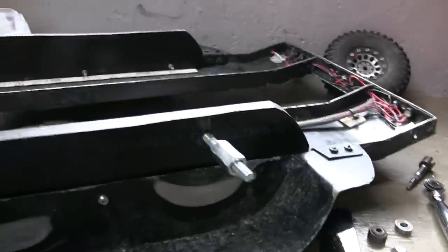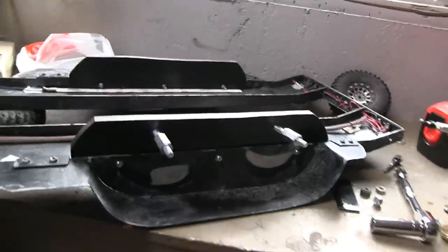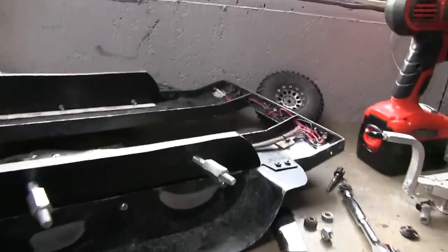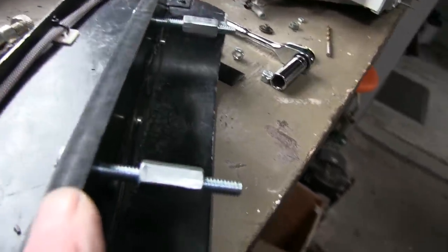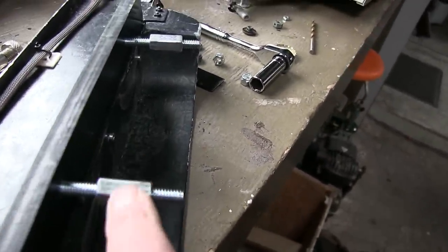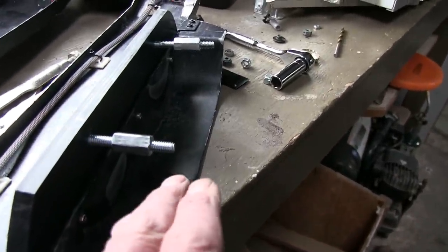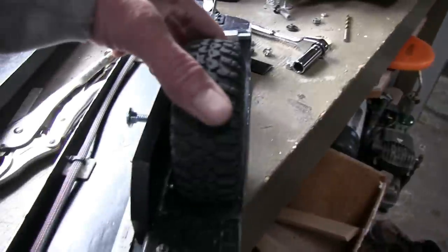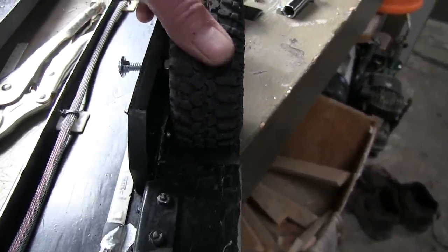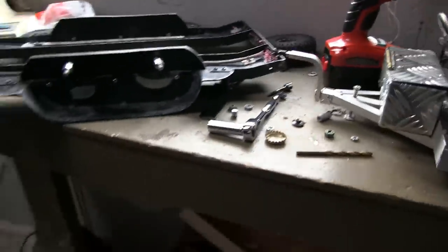I hate to be going downtown or anywhere else and lose a wheel. So I had to pull out these other ones — they're not stainless, I don't know exactly what they are, but they had some ratings listed there. And the bolt coupler — simple coupler that threads on — is going to thread on, hold the carriage bolt, suck it in, hold it into my Delrin. I'm going to thread lock both of those on. From there I just need to get my spacing — a couple washers, maybe a nut or whatever it takes to get the tire sitting exactly where it should in the fender. We can't have it sucked in too far and we don't want it hanging out either.